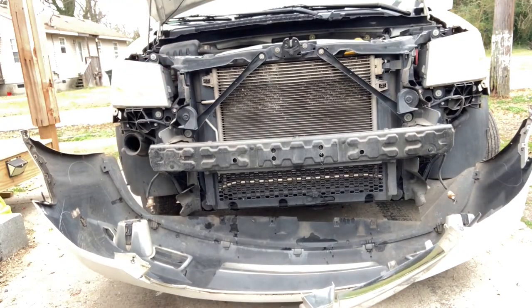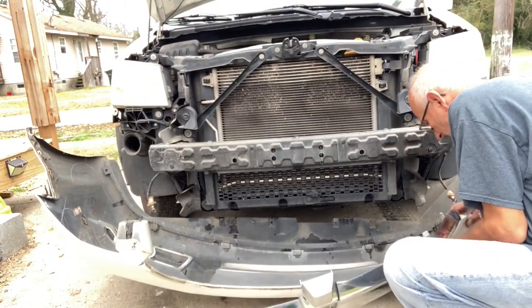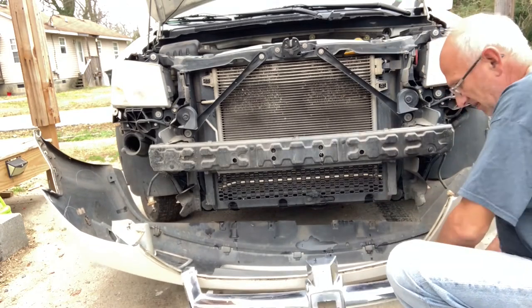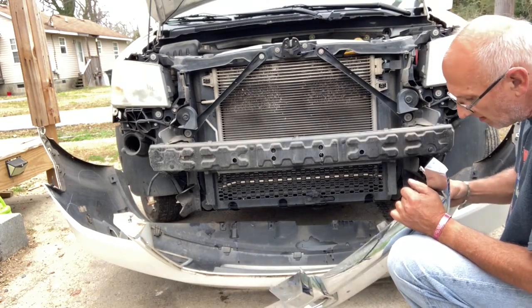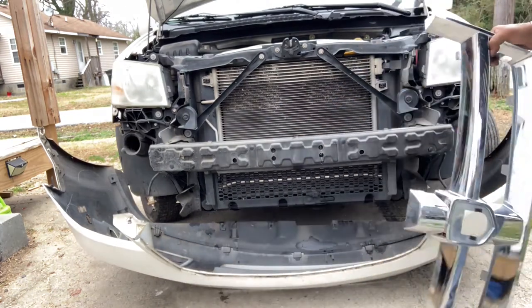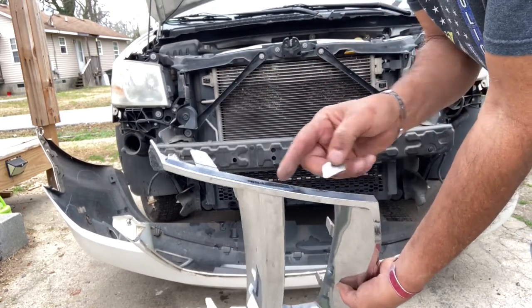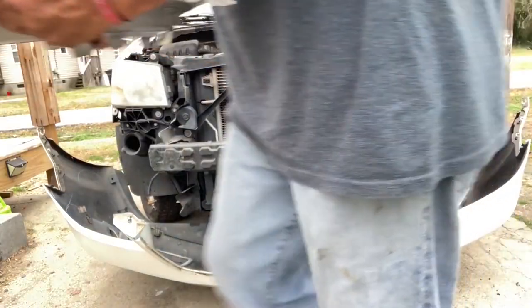Just like that — and at that point the grille is off the car. Now I'm trying to get the two last clips for that chrome grille. I made a boo-boo and broke one of the clips, which will be added to my gluing list. It's not very hard — it's just a basic snap. There's the little piece I broke off, and on the back you can see the clips. Just make sure you've got it in the same direction as the other clips — there are little lips on them.